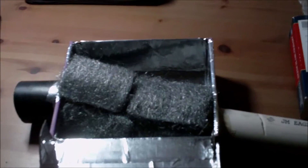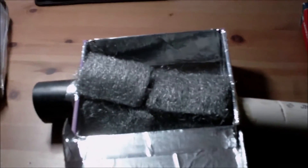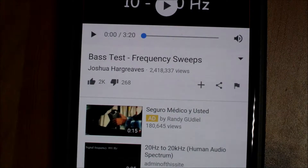Here we are with the coarse steel wool installed in the muffler. It is just positioned around the perforated tube — not wrapped or anything — and there is some empty space, but the effects of it will be noticed. Here's the second test with the coarse steel wool.